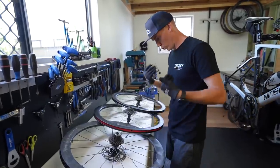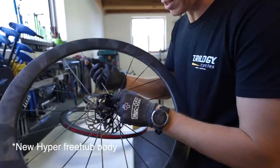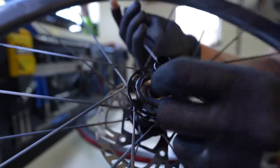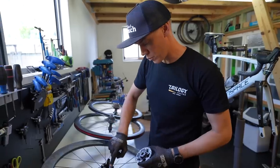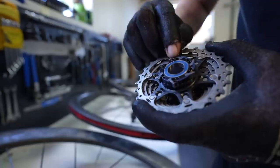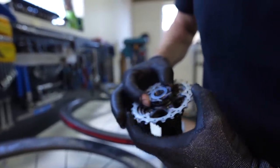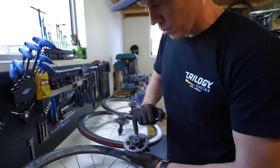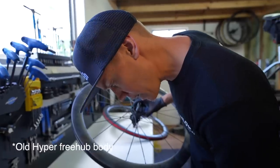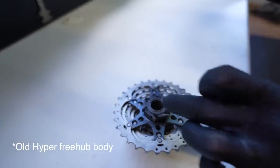The two Hypers — you can just pull these off, they pop like a cork. The design has a lip seal here with a 6903 bearing — a 17mm axle, 03-style bearing — which can be replaced with any aftermarket bearing. It has multiple engagements and six pawls. These are pawl springs. Depending on the brand and how it works, the number of clicks multiplied by the number of pawls gives you a quicker engagement — I think these have a very high engagement. Same free hub body, six pawls, same springs. Doesn't look like they've changed anything there.